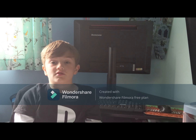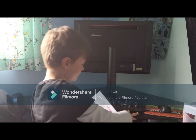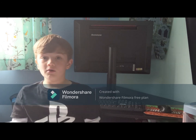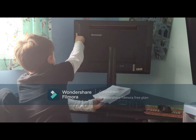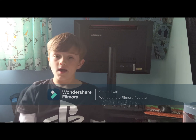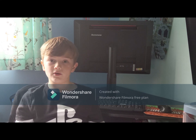One of the first obstacles is figuring how to wire it up. If the mini PCIe is here, how do we get the wire out? Well, on the opposite side is the location of where an optical drive would go. This was an optional extra and wasn't installed in my computer. If we remove the blanking plate, then the wire should easily exit the casing. So let's open it up then.